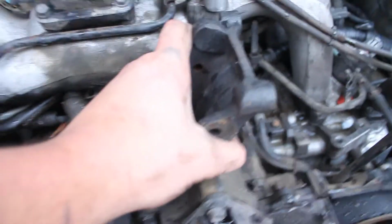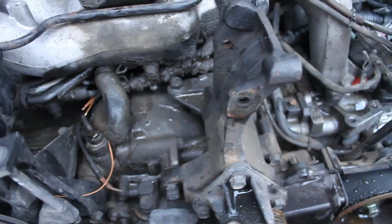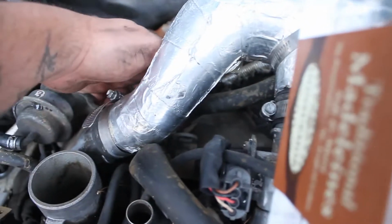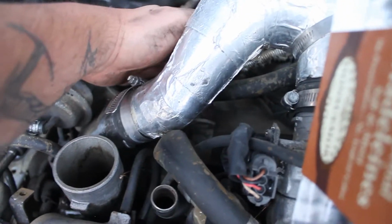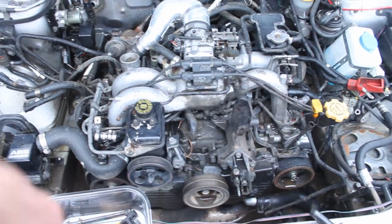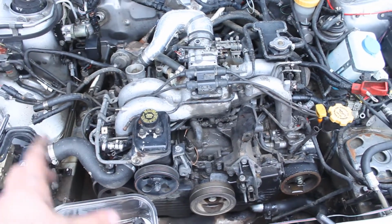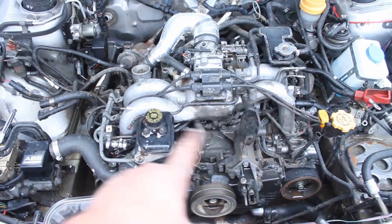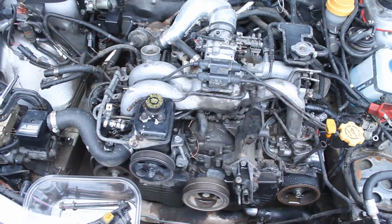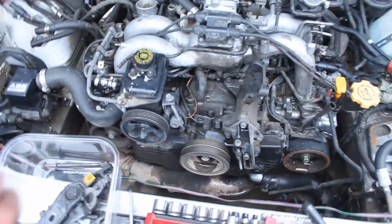As you saw, this bracket was loose, so I just snugged it up, and I'm probably gonna grab onto it with the lift there, and then there's that little ring right here. Grab onto those. I'll just lift the whole engine out with the turbo on it, put it on my new engine stand, and then start stripping this one down, because this short block is getting the heads and everything, the whole top end off that other mock-up engine I got.